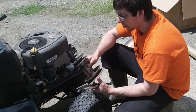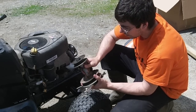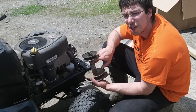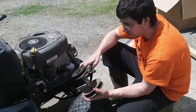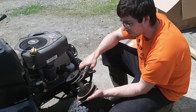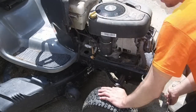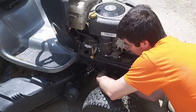This engine pulley ended up being a lot more stuck than I was planning on, so here's another trick. Up on the engine pulley near the drive belt pulley you'll see a cutout for the key that goes onto the shaft. If you get a decent-sized set of vice grips, you can lock the front nub of the vice grip onto that key and then use it to hold the pulley while you turn the bolt. Here we have the vice grips in place — let's see what we can do.